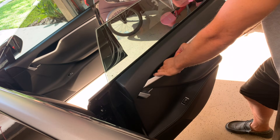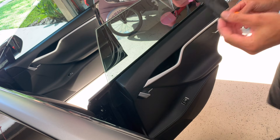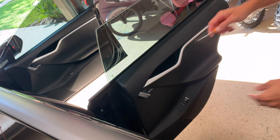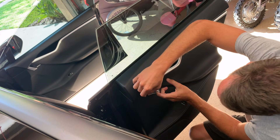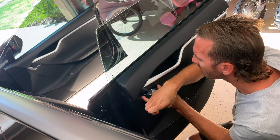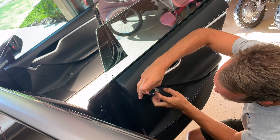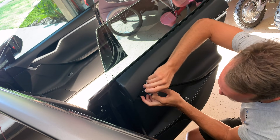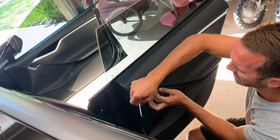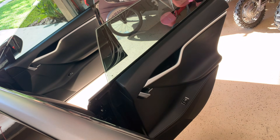What you're going to want to do is remove this rubber grommet. Be careful because you have that piece of brushed aluminum and you don't want to scratch it. Next, remove this plastic cover that goes behind the door handle switch. It's not held on to anything — it's just pressed in there with a couple of little tabs that go into holes.